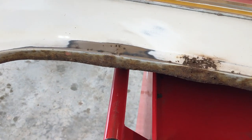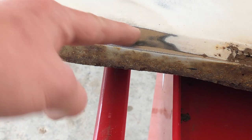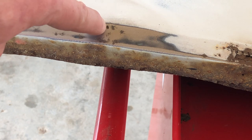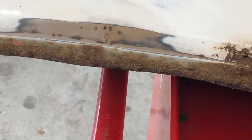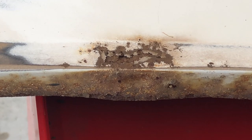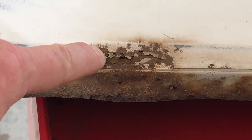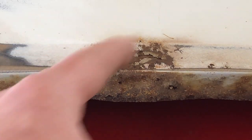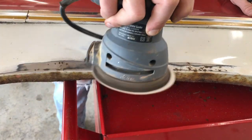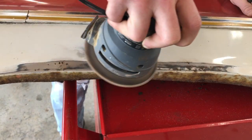When it comes to bodywork on an old truck like this, you'll see that some of this rust in this area sanded off nicely. There is a pinhole — I should be able to plug weld that. However, you look over here where I started grinding away, and even though it was just bubbling inside the paint, you can tell that it's fully rotted out. So unfortunately, we will have to cut this out and make a patch. We'll continue sanding so that way we know where the good metal starts and how big we have to make our patch.